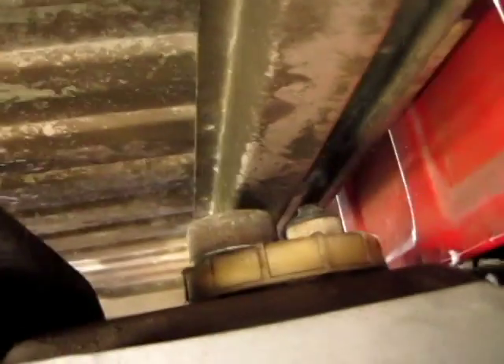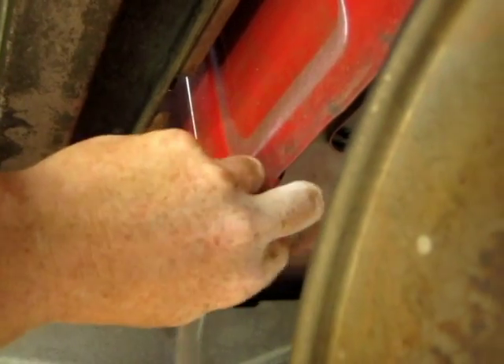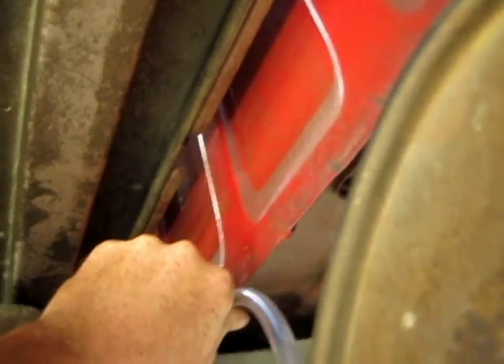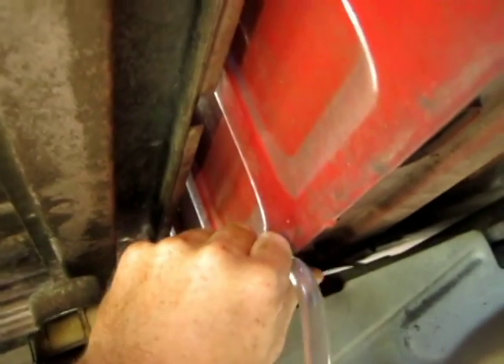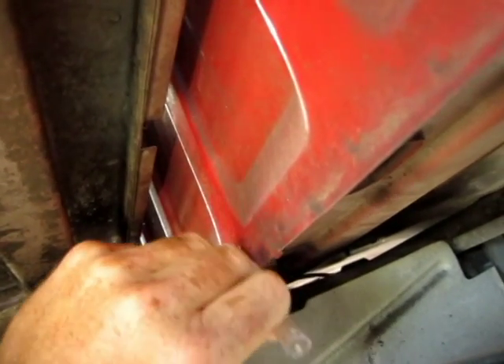This is a side view — you can see that little flange sticking out from the cab. The cab is on the left, the gas tank is kind of on the right. If you loosen those two bolts on the gas tank view, you can drop the tank down just a little, maybe like a half inch or so. Now this is on top of the gas tank — you can't stick your head inside there, but I can stick the camera up there, that's why it's shaking so bad. There is the flange right there, rubbing right against the top of the tank. This is probably happening because the body mounts are worn and compressed somewhat, taking a little bit of the clearance out — probably just a fraction of an inch, but just enough to annoy the heck out of you if you heard this squeak.